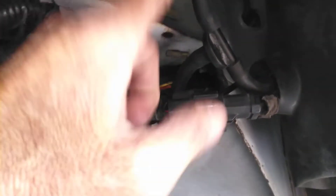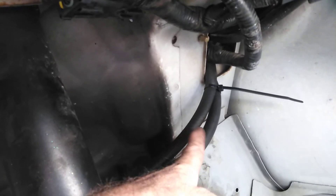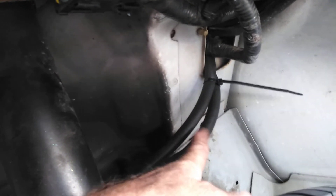Let me explain what's going on today. I jacked this up and I had the cruise control line blocked off here. The second line went ahead to the booster. This one went back to the intake. I put a 7mm long quarter-inch socket in between and pushed it up — you can probably see it right there. Now that goes straight to the booster, and the aftermarket canister goes straight to the intake.